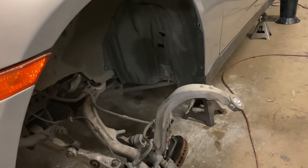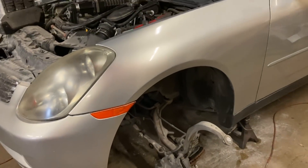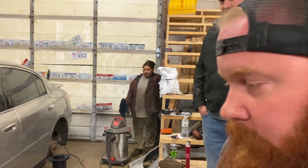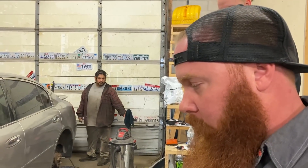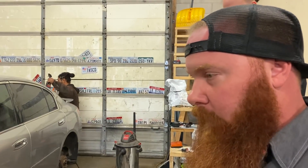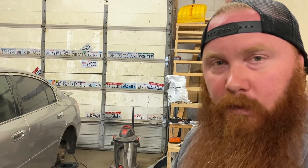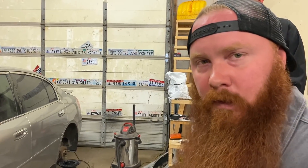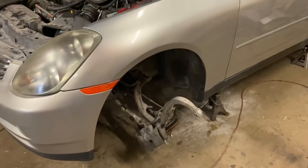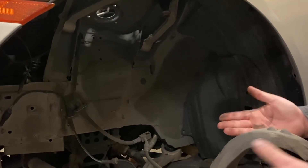Sorry we didn't film gutting this all out, but the struts are all going to get replaced. So on this, we obviously wanted to alter the look of the car because it was bone stock and like a four-by-four. What we're actually going to do to keep a stiffer stock height, we're going to put 350Z factory suspension on this — not coilovers, but the 350Z struts lower this car between two and three inches. Is that a direct swap? Yep, they bolt right on — one bolt here, three bolts there.